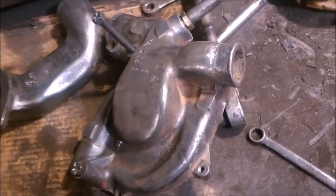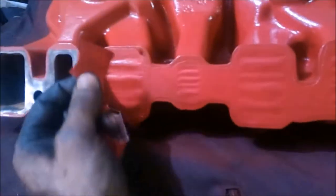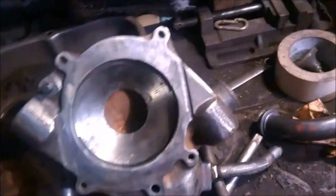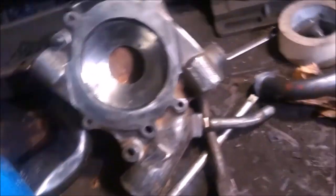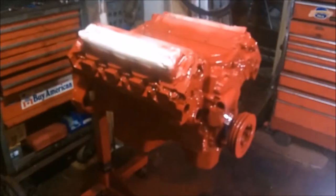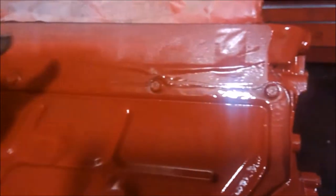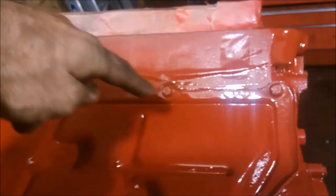Remove our masking — we went a little over on the edges, no big deal, sand them up. Same as we did there on the underside: mask, tape off our gasket, cut around it, and paint the underside since we can't get at it later. This is a couple rattle cans full of engine enamel — 500 degree. Tape off, trace off the gasket, cut off the bottom so that edge that won't be contacted gets protected. Put a little Vaseline around the edge of the seal with a brush so we don't paint the seal. Put in some crappy spark plugs — as soon as it flashes, pull the tape off, otherwise you'll get a tape line.